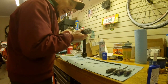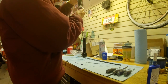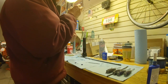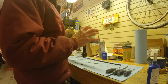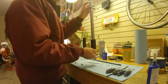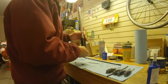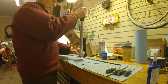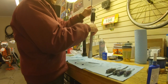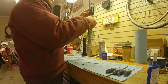Now I'm no expert — I don't mean to appear to be — I'm just trying to help guys that might have 4CS forks, because I found a number of people posting about this issue with no resolution. This is clearly a problem. I don't know exactly how this fork works, but the cartridge is full of oil. When the seal is bad, the oil just pours out on the floor — that was my first indicator. The other sign is when you use compressed air to bleed the fork, the damper rod just drops instead of standing up.